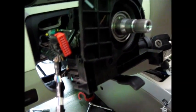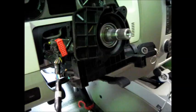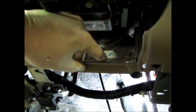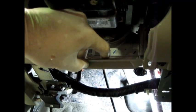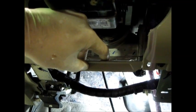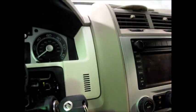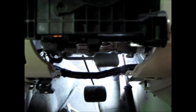Now we're ready to put the switches back on — our multi-function switch and our clock spring — and then we can put all the trim bits back on. It's really pretty simple, not much to do. The only other note is that when you're taking this apart, on this lower trim piece you'll find a plastic piece in there. That plastic piece is just there to keep things sturdy through the manufacturing process. In order to get this column out you're going to completely remove it — just cut it out and leave it out — because it serves no function once this panel is installed in the vehicle. This trim goes all the way up around the dash on this Mariner, so make sure you cut that piece out when going back together.